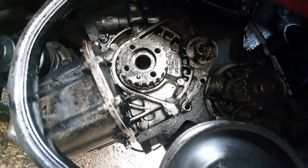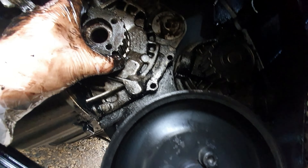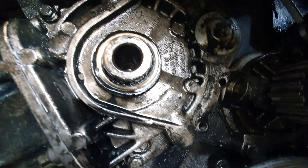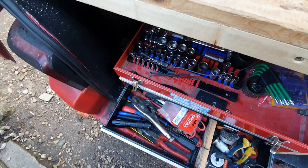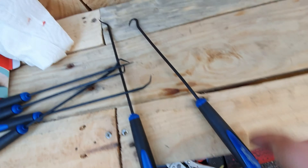What an absolute mess — I am covered and everything is just thick with oil, absolutely caked in it. I haven't actually pulled that off yet. I'm guessing the seal underneath it is absolutely shot — yep, might as well not even be in there. Look at the oil, it's literally dripping off. I'll give everything a good clean and pull that seal out. Last time — I'll try and link the video — I was using screws to try and get the seal in, but now I've bought myself a set of picks, angled and non-angled, so hopefully they'll help.